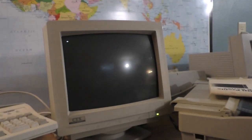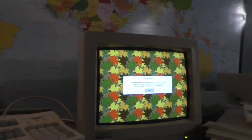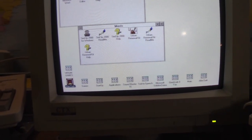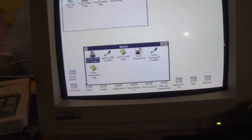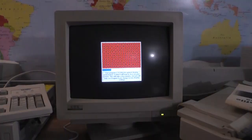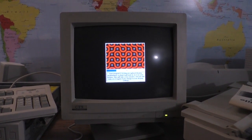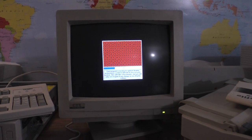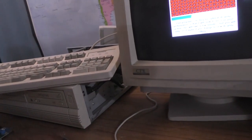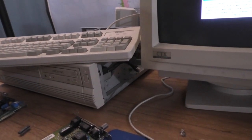If the onboard RAM is bad, we'll know pretty much as soon as Windows boots. If we still get those artifacts, we might have to dumb down the video mode a little bit — I think I have it set to 800 by 600. Actually, it didn't make a difference in the grand scheme of things. Do we still have the artifacts? So far, no. I think we got it. I'm launching SimCity. It looks like it's 512K — or is it 256K of onboard video memory? Let's see what we got.